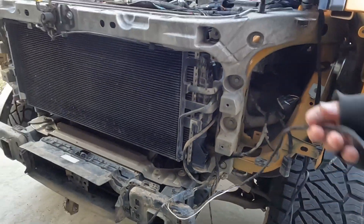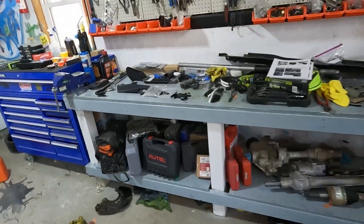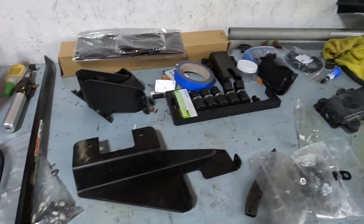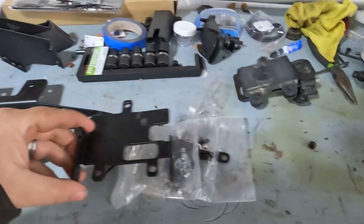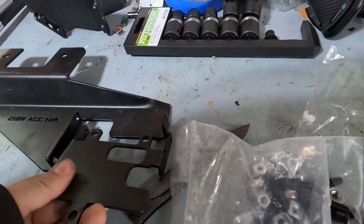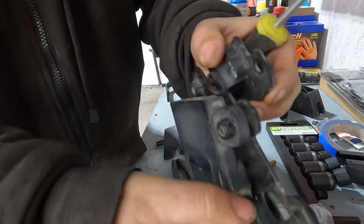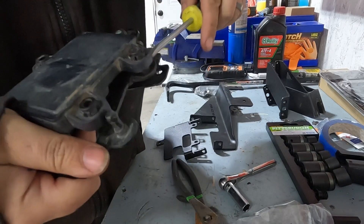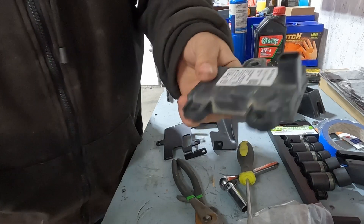We've got this wire separated and it's going to go up to right about here. Before we finalize all that, I'm going to go ahead and put this bracket together. This is from Bodyguard Bumpers — the one that Front Buster sent with the relocation kits. We need to move this from its current mount over to this new mount, and then this will get mounted into here. We've been sitting here trying to figure out how to get this plastic screw out, and apparently it's not a plastic screw — it's just a little stud and a little plastic insert that it goes into, and it just pops right off. Now we've got to take these inserts out.